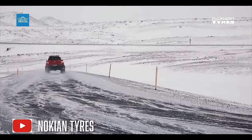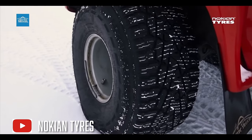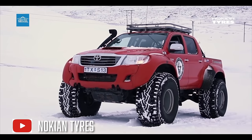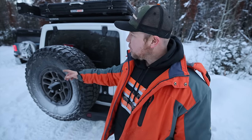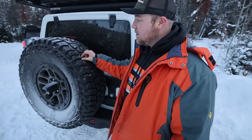This got me thinking how important it is to not look at what it says on the side of the tire, but to look at the tread design and read the design itself and decide: is this going to hold onto the snow? Is this going to bite? Or even though this says all-terrain, is it actually designed a little bit more like a hybrid tire? Not all all-terrains are created equal, and not all all-terrains are great in the snow. What you need to look for when you're shopping isn't just the three-peak rating, which we'll explain later in the video, or the fact that it says all-terrain.